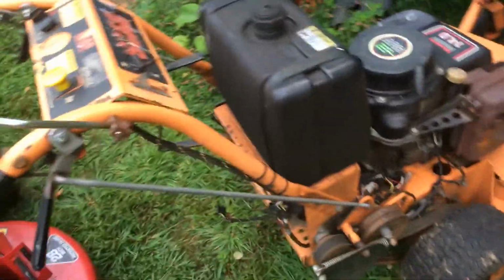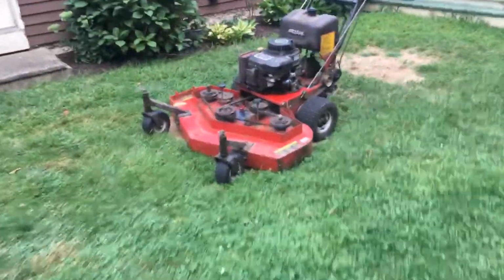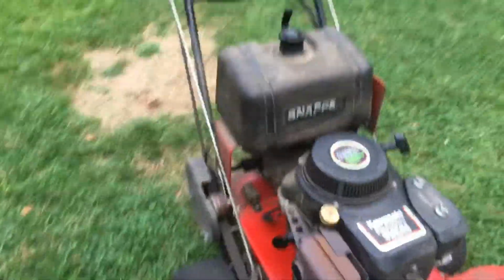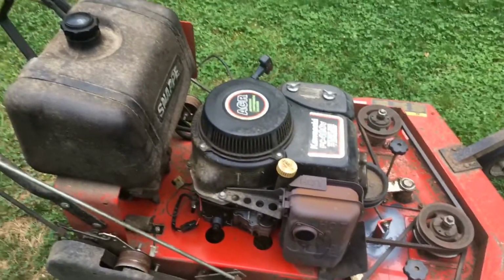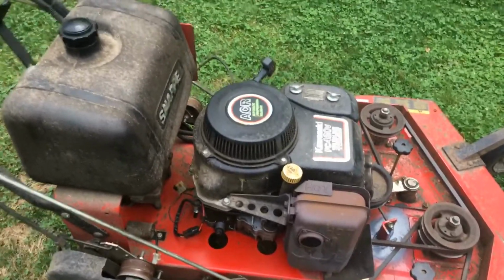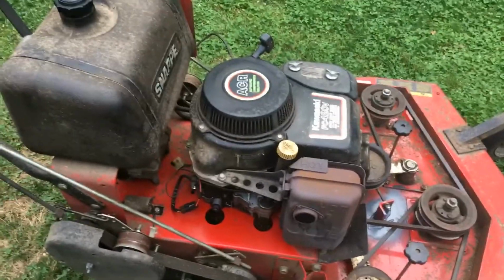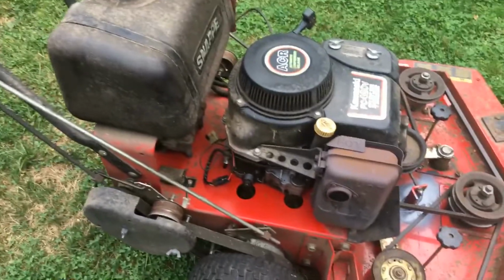But at this point, it's electrical, and you know, this one was charging great too. This one was charging at like 27 to 30 volts AC, so everything was fine. So I'm assuming it's just the rectifier regulator that's at fault. But if anyone has any experience with these rectifier regulators on these non-battery electric PTO driven walk-behinds with the Kawies, let me know, because I'd like to get someone that has experience with this that could maybe help me out.